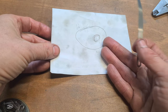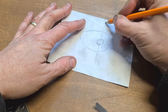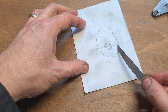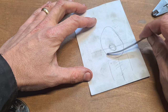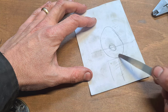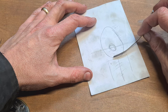So if you want to check those valve clearances, another way of doing it is make sure that cam is pointing away from the bucket. That's the line here. All right, so this area here, this circumference, let's say the valve bucket itself is there, and your valve's in here. As long as you are within this region on your cam, you can check that clearance, because this should not touch the valve bucket. Only when it starts to come around here does it touch. So you're not going to get a reading from that, but here you should be able to put your feeler gauge in.